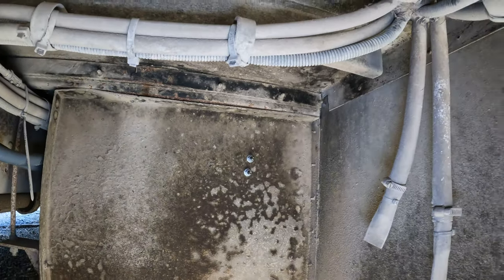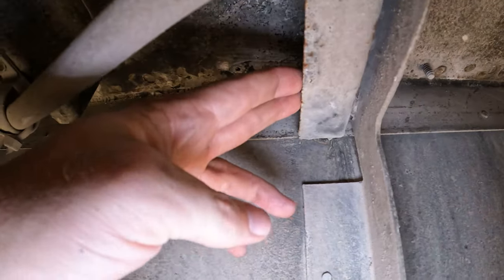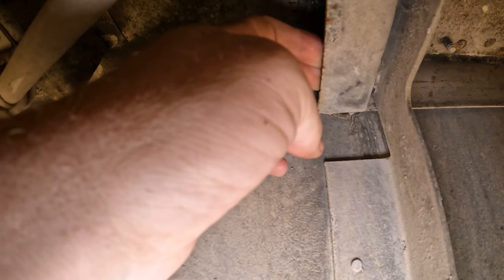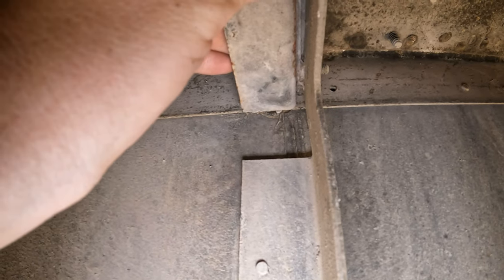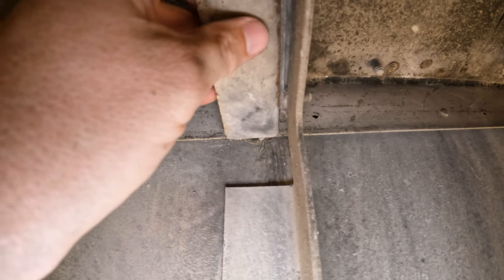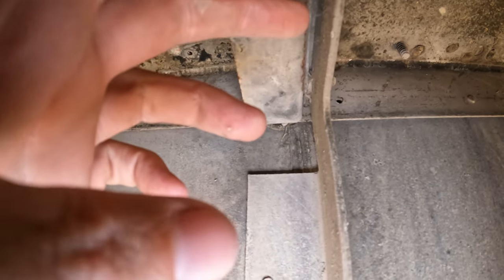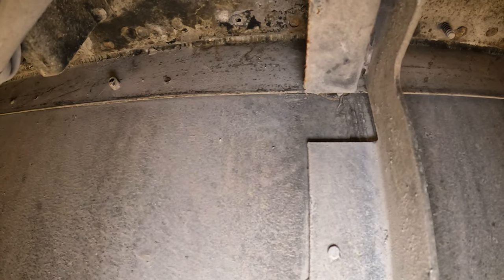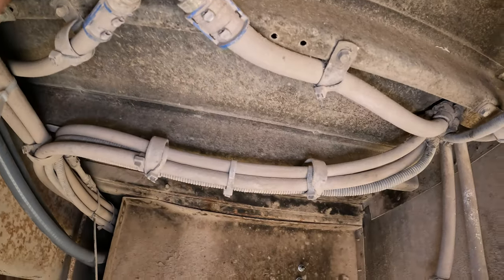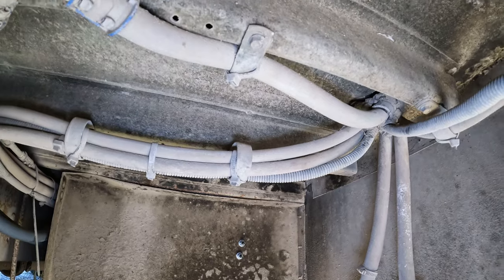Good. Then over here, this one is open. Let me make sure I can see what you see. So this one is a standard U-style channel, just like I bolted to in the back when I was putting up the propane mounts. And this one is just under 30 inches, so I should be able to reach up there and grab it pretty easily. Now here we do have a support for the side curtain that I need to make sure I don't damage. So this will be a piece of 3-inch channel sitting lengthwise this direction, I think, which means I'm going to have to bolt it with a single bolt going through. But I can do the same thing over here on this end once I get all this stuff down. So all this stuff is left over from the old air conditioning units.